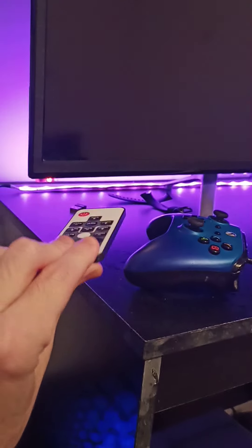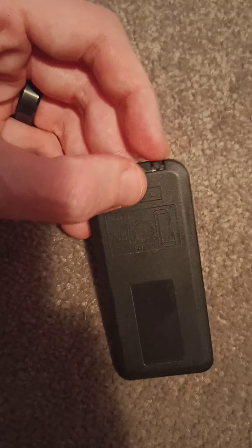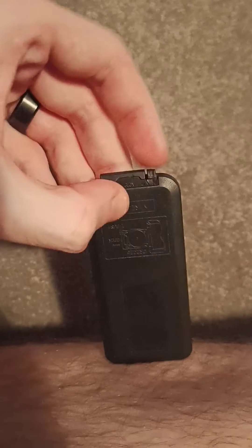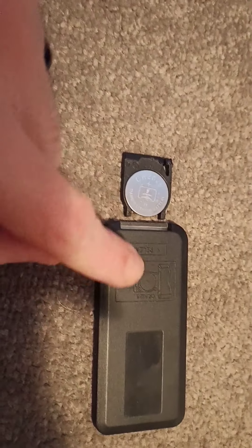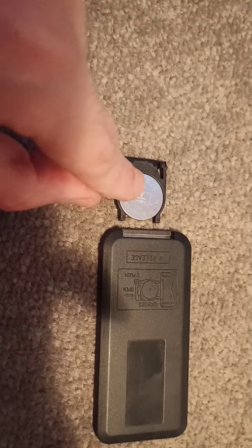This one uses this remote. Once you have tried that step with the four pins and changing that around, go to your remote and check the battery in it. See how it has this little square part here on its own — you have to pull to the left and pull up at the same time for it to unlock and come out. Make sure that it goes back in this exact way, so the remote is facing this way and the positive on the battery is facing upwards.